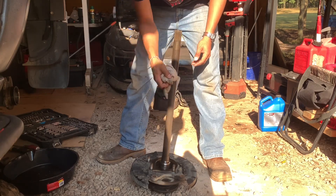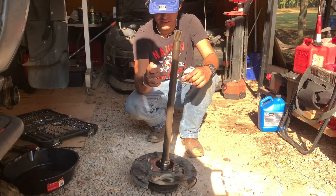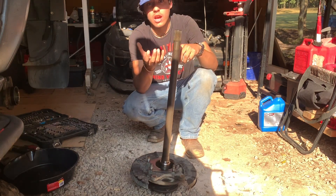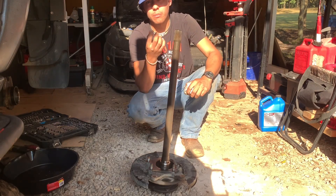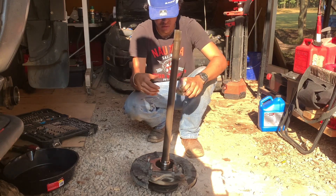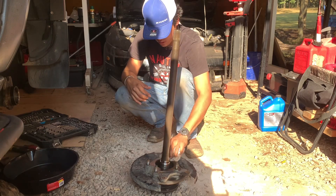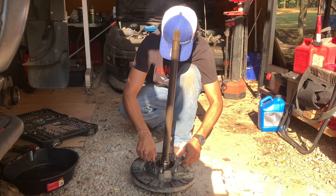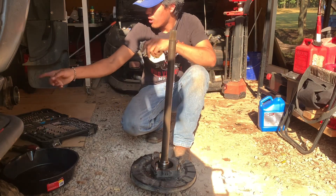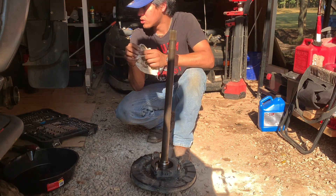So there's my assembly right there. Since I'm replacing the seal, I don't have to worry about being too cautious about letting it scrape against it. But if you ever do this and don't plan on replacing your seal — which, if you're at this point, you might as well — be careful not to let the shaft fall onto the seal and drag across it, because that can pinch it, tear it, or cause imperfections that lead to leaking. If you're even remotely close to doing something like this, just go ahead and replace your seal. I'm going to clean this up, get the hub assembly off the axle shaft, remove the outer bearing, clean up the face of the axle tube, and pull that seal out, then start putting in the new ones.